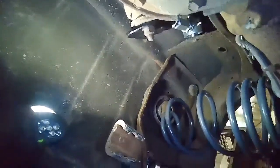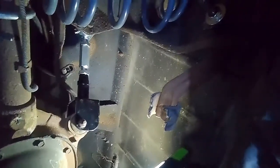I don't usually do that just because if you've got older bolts and nuts, and there's debris in the threads and whatnot, hitting them with that impact has all the more potential for galling threads and, you know, just heating up too much and basically tearing threads off old bolts to where you're basically welding this nut to the bolt. And the next time you go to pull it off, it's a no-go.